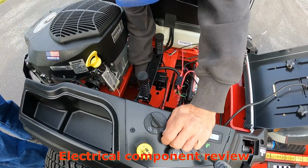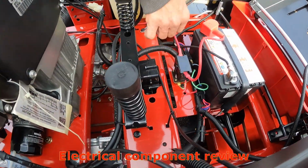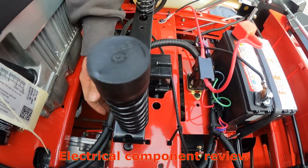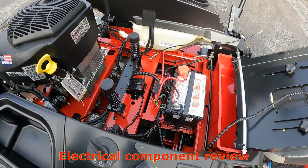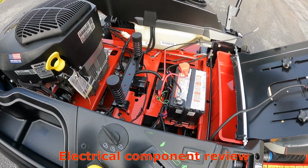I want to show you. Notice how it's a steel pin coming out of the motor. Then you got a plastic receiver that then again goes to a steel pin. So you got that intermediate portion. So be careful if you're unsetting it like that with no battery voltage, that you don't jam it forward and break those, because then you have to purchase the whole motor.